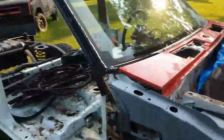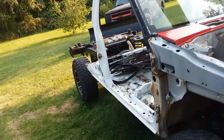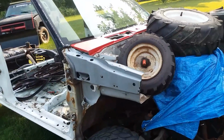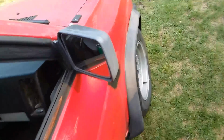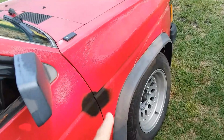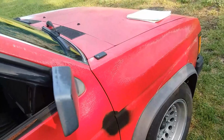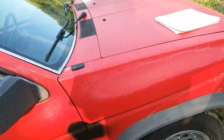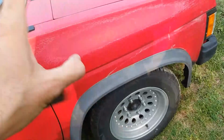The disappointing news is about a product that's not really a sponsor of the channel per se, but I really do endorse their products a lot. I had them on my Chevy, I have them on the green truck, and I have them on this red truck here. Performance Friction brake pads. This one's got the 4-cylinder calipers on it with the 4-cylinder pads, obviously. The green truck has the V6 calipers with the V6 pads, the twin piston calipers. Nice upgrade. Bolt on. You can run a slightly bigger rotor with that setup. With this truck, I just went with the Performance Friction pads and the stainless brake lines.